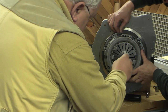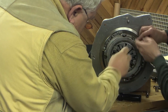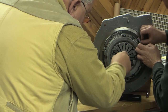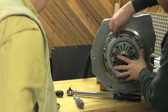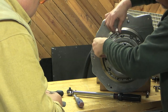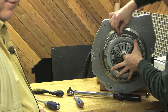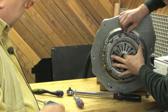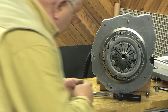Let me show you a trick — we've actually got the center in the coupler, and I got this tool that will go through it. It kind of does it. You might be able to move it around — I can move it closer. I'm going to put all the bolts in. If I can just get two of them started, that thing won't move, then we can slip it into position. We can look down through the clutch at the center — it's like a pilot point where the chuck went into our coupler. If we can get that visually centered, this just has to be centered until we get the transmission shaft into the clutch. So we want it pretty well centered, but this is not as critical as it looks.